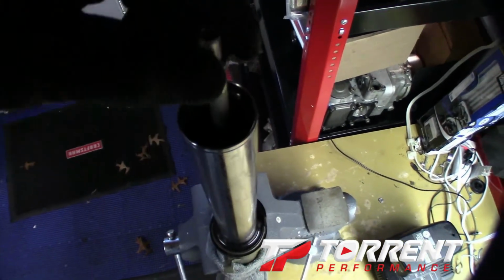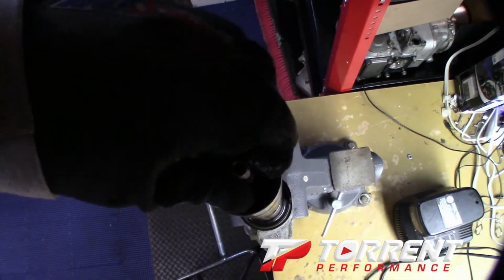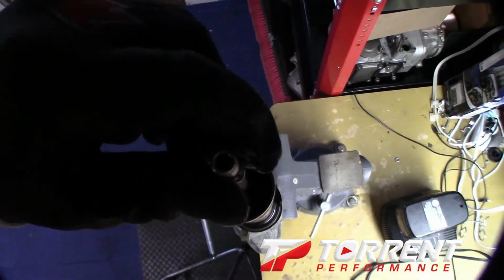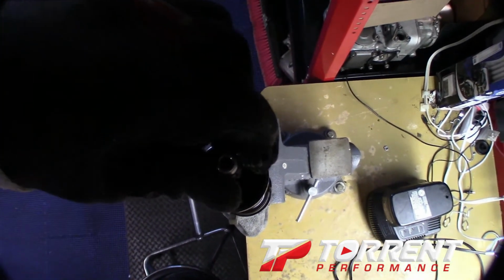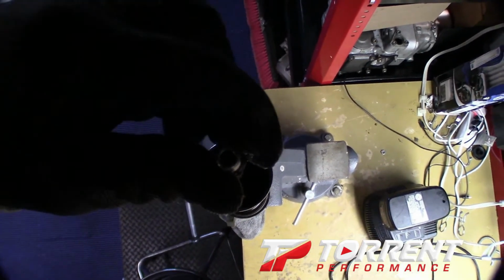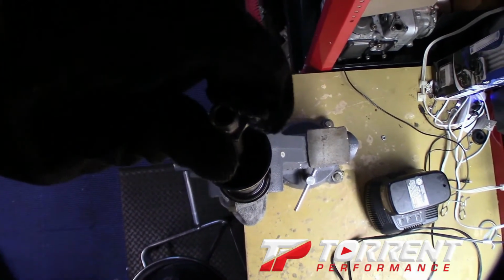You're going to pump this rod until you see the fluid come out of the top of the rod. See, it's starting to get primed right now. And it's sucking all the fork oil into the rod system, and it'll come out. There it goes. See, it's starting to come out. That means it's primed. Just do it slow. And you're forcing all the air out of it.